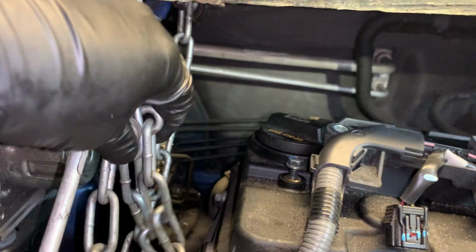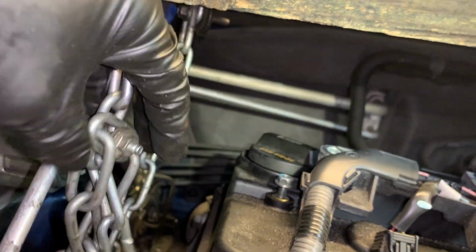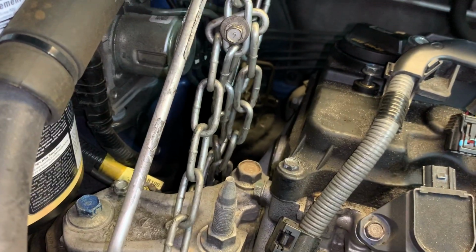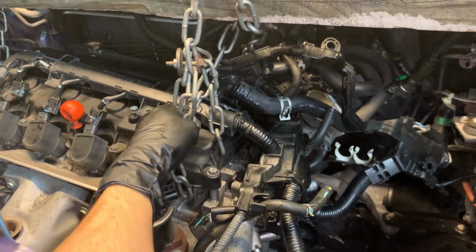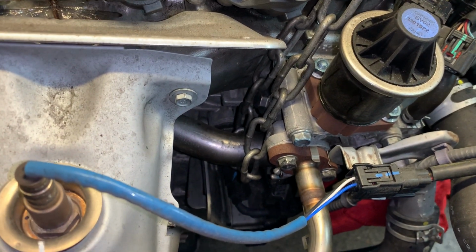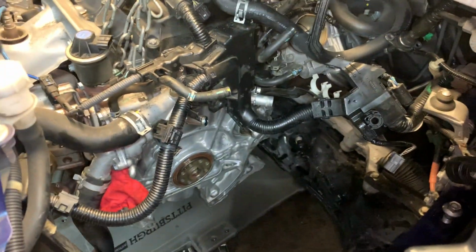Yeah. And then I came and I got some chains and some bolts, and I chained up to the motor mount here. Now, if you can see, this is loose, but I put it there just for safety, just for prevention. What's really holding the weight here is this chain. This one with the tension on it, right? So I have that onto the metal pipe on the back of the water pump. It's strong enough to hold the weight of this little 1.8 engine. And I have the transmission out already, as you can see.